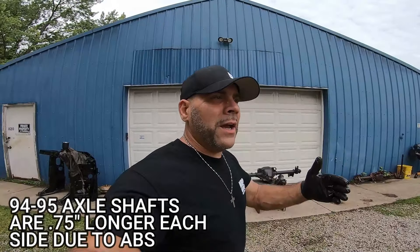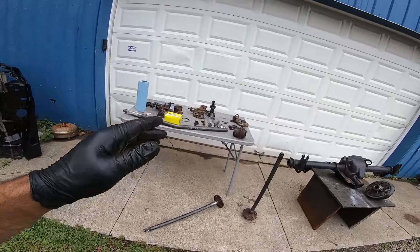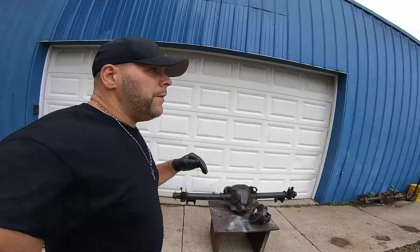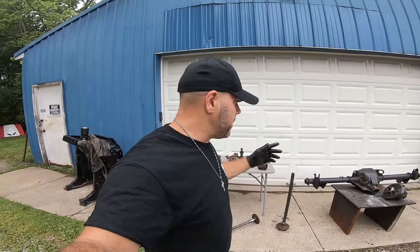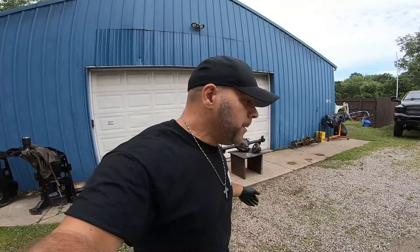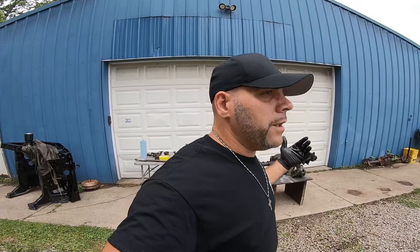We're trying to do this on the budget — as cheap as we can — and make it work. It's 31-spline, it'll handle every bit of 750–800 horsepower, and it caters to a lot of people in the 8.8 fox body world. We're going to modify one axle for the black car with rear drums using the c-clip eliminator and machine work, and then build another axle later and do the rear disc from the Explorer to see how well that works. Next video you'll see us starting to assemble this junkyard 8.8 31-spline axle. If you enjoy this content, comment below, check the join button for membership, and check out the T-shirts at neomustangs.com.